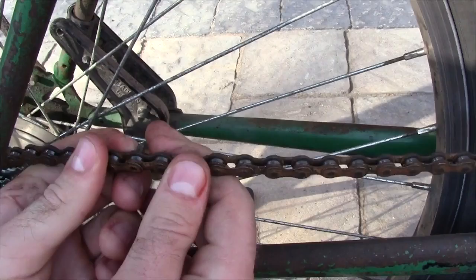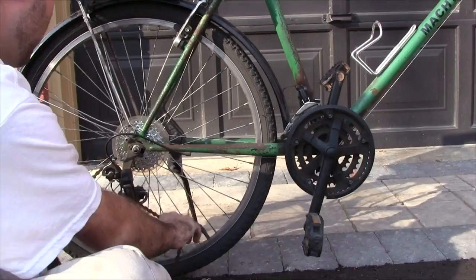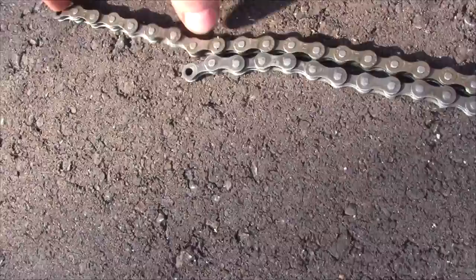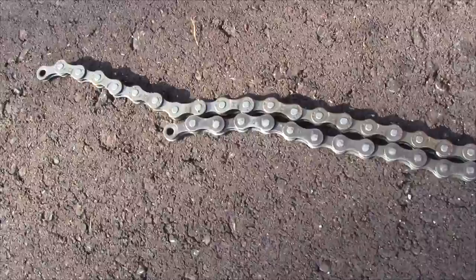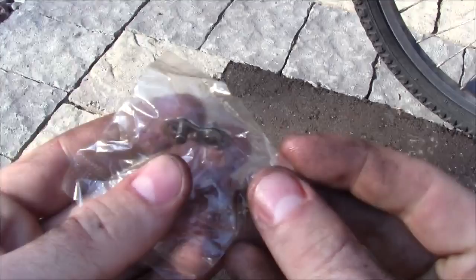We don't want to completely remove the pin in case we ever want to put this chain back on another bike. Now just back this off, take the chain tool off, and then we should be able to pull the chain apart. To separate it, just bend it back and forth and it should come right out. With the chain disconnected, you should be able to just pull it through and get it off the bike completely. This is the new chain laid out next to the old chain, because I want to shorten the new chain to the same length as the existing one so it will fit on the bike properly. The new chain comes with a few extra links just to make sure you have enough. I'm going to take those extra links off and put them in my parts bin for if I ever break one of these links.